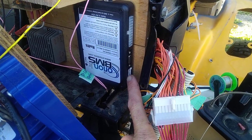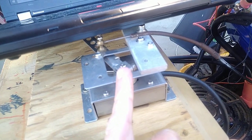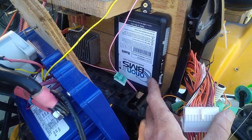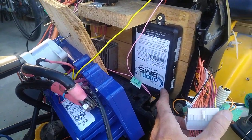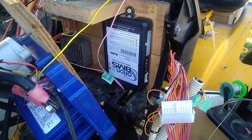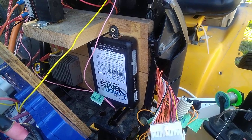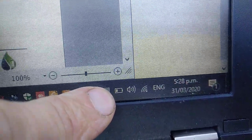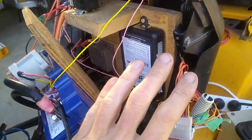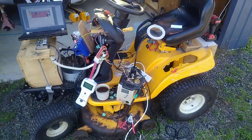I need to get on and wire all of this — things like the charge relays and the current sensors. The really nice thing is your throttle takes a five-volt input — you've got a potentiometer that's a five-volt input — you can wire it through this so when the battery starts to get low it will reduce that five volts. So even if you're on full throttle it will cut the power slightly, which means you don't over-spike a flat battery, and it gives the operator feedback that the battery is going flat.